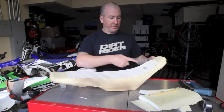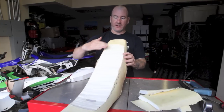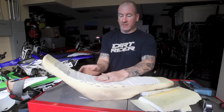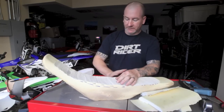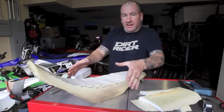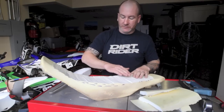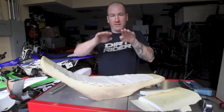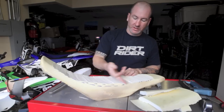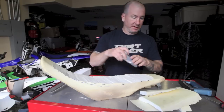There's our first run through — my mistake. I like to look down and make sure I've cut it pretty level, then come back through with the knife. We still have a lot of foam in the middle, but I want to keep the height in the middle and shave down the sides. The worst thing you can have is a flat seat that's low, because it just bows your legs out and doesn't help them reach the ground at an angle. If you leave the middle high and shave down the sides, when you sit on it your legs reach the ground instead of bowing out. So I'll cut 45-degree angles and work it down, then use the shaver to ease the shape into the seat.